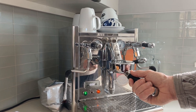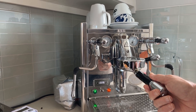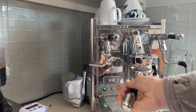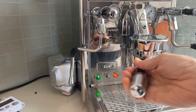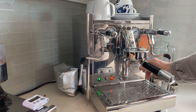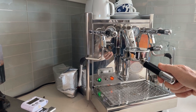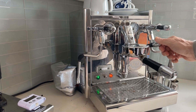That cleaning cycle on the PID display — you can program the cleaning cycle, how often you would like to clean your machine. I like to clean my machine about once every 30 pulls, so I program it to do that every 30 pulls. That can be switched to however many times you'd like. For me, that works out to be about once a week. For you, if you make more, you might set it to 50 pulls or something like that.